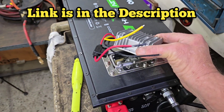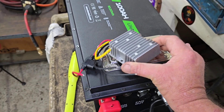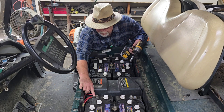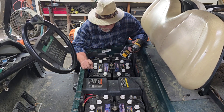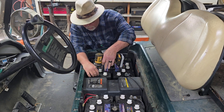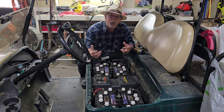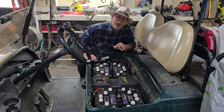That's why I bought this 48-to-12 converter to run our headlights — I think it was 20 bucks or something. Pretty cheap. That's your main positive, and here's your main negative coming out going into the box. When you go to do these, be sure your switches are off. Start with the negative cable. I'm going to undo all these and get these batteries out of here, and I'll show you what we're going to do.